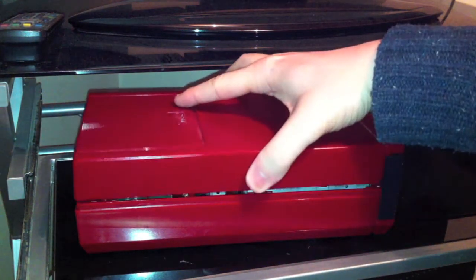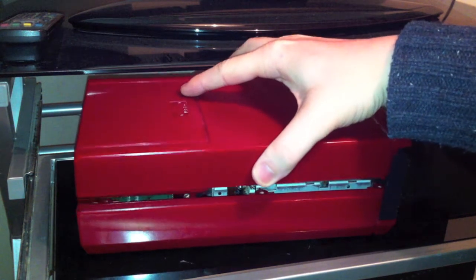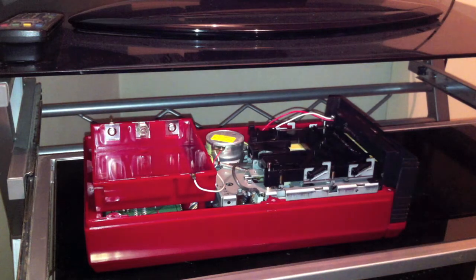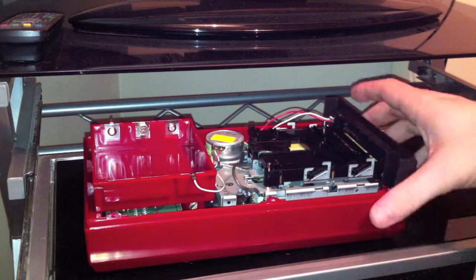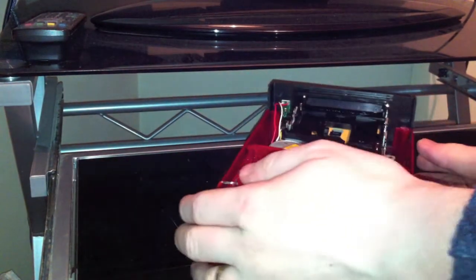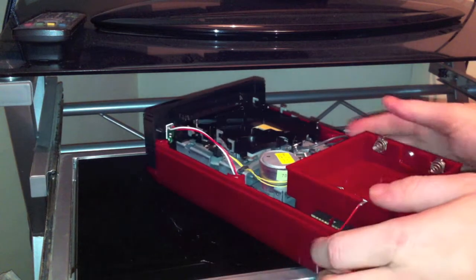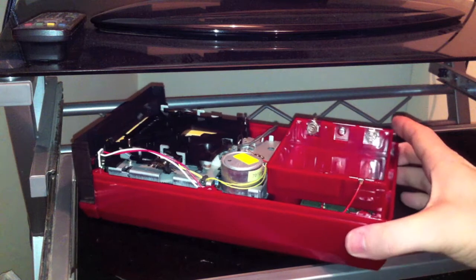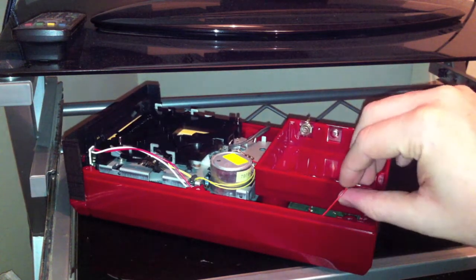When I'm recording this video, I've taken all the screws out first so I don't have to bother recording taking out screws because that can be boring. The first thing you do is take the top panel off. There are six screws underneath before you can take that off. And what you need to do is get the main disc drive, which is a big metal bit in the middle there, out.